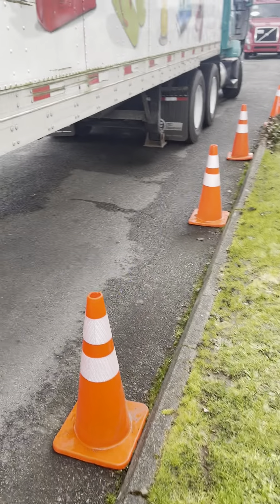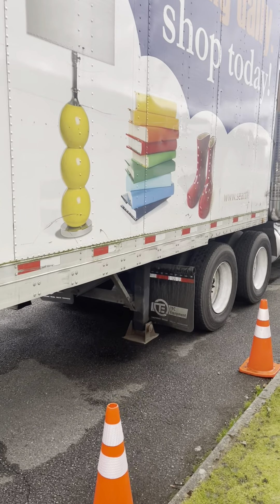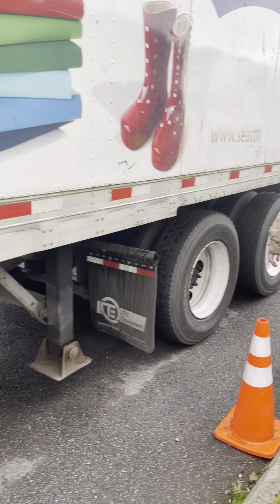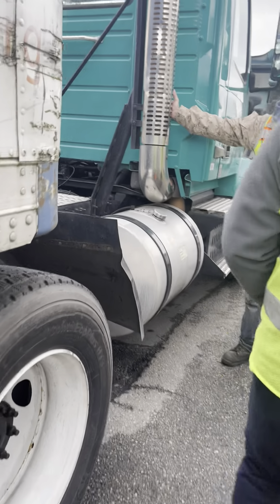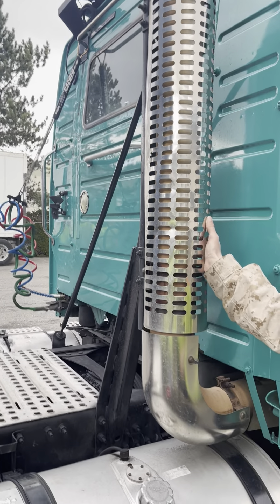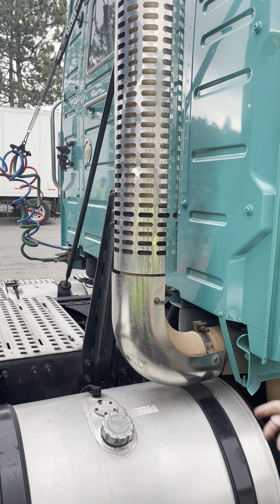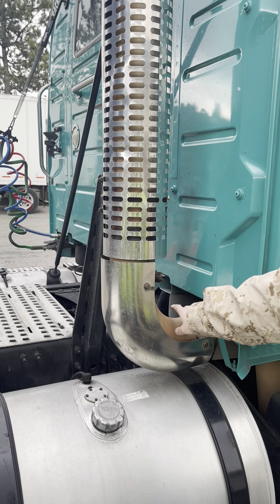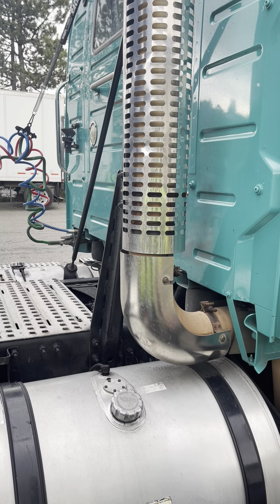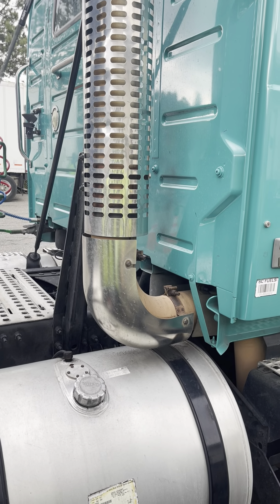I will check this side the same as the other side, except for the exhaust. The exhaust is securely mounted and tight. There are no cracks, big dents, or holes. There are no loose or missing clamps. And there is no rust or carbon soot that would indicate leaks. And this completes the outcab inspection.